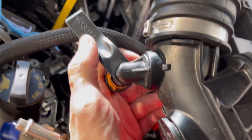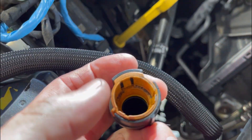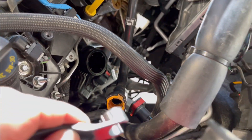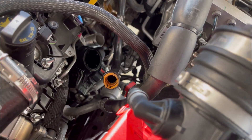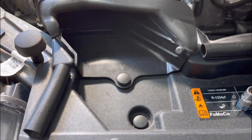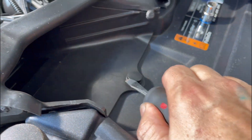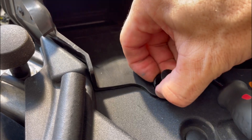For this to work you've got to line up these tabs. You see these two tabs — you're going to make sure this tool lines up with the two little tabs on the bottom, press it in, and then you'll be able to pull this out. It'll kind of look like this — press that down in here and you can pull this whole housing up and out. Now we're going to remove this little clip — just pry something under it, pull that top one, and you can pull that whole pin out.